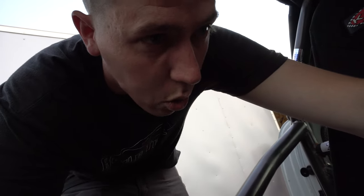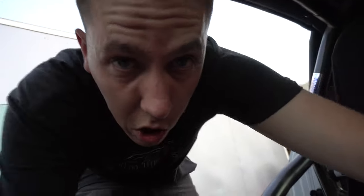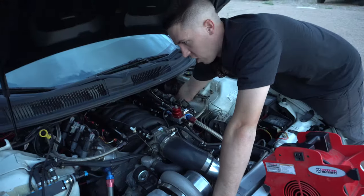On that pass it usually would go 5.80 at like 121, 122. So I'm thinking that either the tranny's letting it push through, or I got a bad plug or a couple plugs. So might need to check plugs and switch them out before tomorrow — pulling all the plugs.